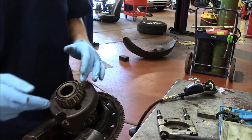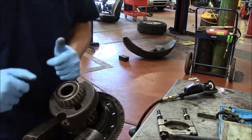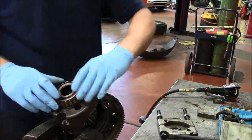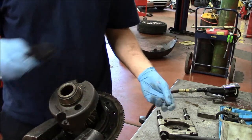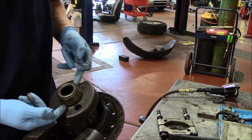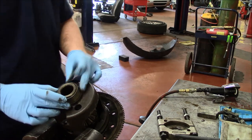What I'm going to show you is a way that we can take press-fit bearings off of a shaft if we're having a hard time with the puller or even the bearing splitter — because the inner race doesn't give us enough area to hang on to. It's a really simple process. What we're going to do is cut the cage off — the cage holds the rollers in place. Then we're going to put a cut on the inner race, fracture it with a chisel, and pull it off. Once we cut the cage off, we lose all those rollers and we're left with the inner race. There's just not much of a ledge to grab the inner race, so it's just as easy to make a slice on the inner race and relieve the tension of the bearing around the differential. That's what we're going to do now.